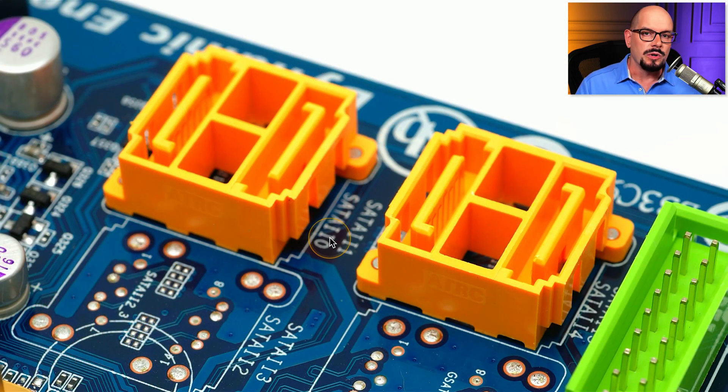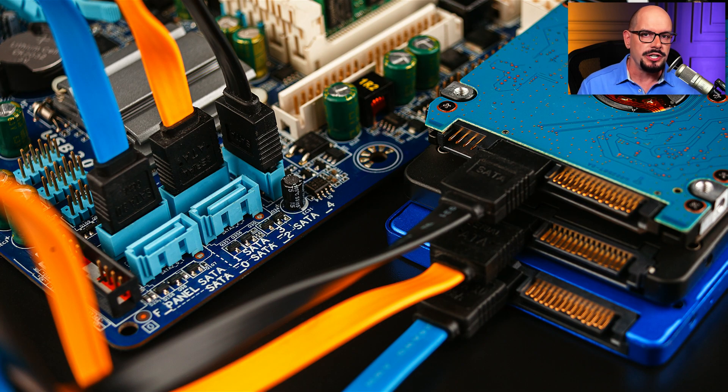Here's another motherboard with a slightly different alignment of SATA connections, and this motherboard appears to support four different SATA data connections. It's a one-to-one relationship between the connector on the motherboard and the connector on the storage drive. You can see blue, orange, and black cables coming from the SATA connections on this motherboard, corresponding to the blue, orange, and black data connectors on these drives. They'll also need power, so we need to plug in the SATA power connectors on each of these drives.